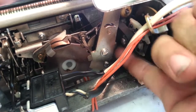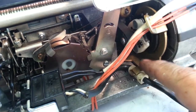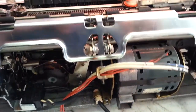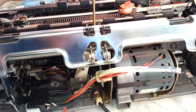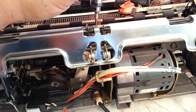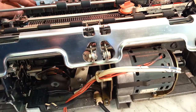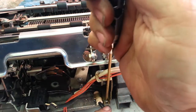And I'm just going to stick my finger under here and do a little tension test. That feels about right. It flexes a little bit. It can't be too tight, can't be too loose. I think that one's just right. And since it's just right, I'm going to drive the screwdriver down the center here and tighten up that back one by going down to the top here. The belt's kind of in the way, but you just move it out of the way. Get to that last adjustment, or that screw from the bracket. Tighten it up. Check everything again. Looking good. Tighten this back one up.